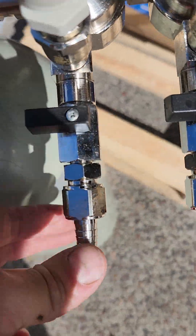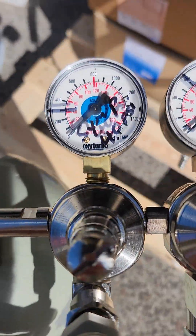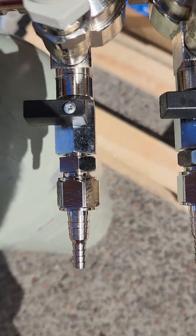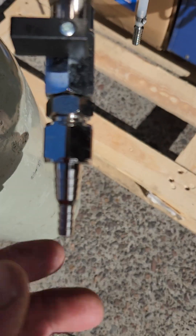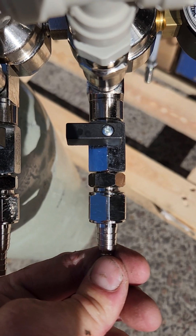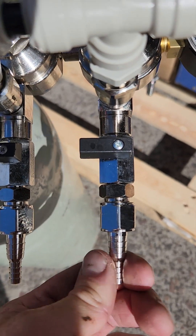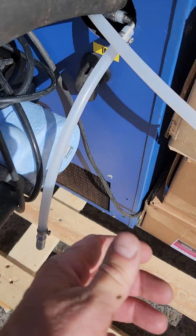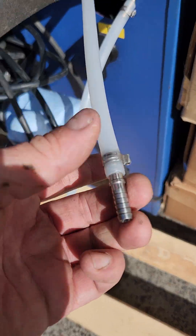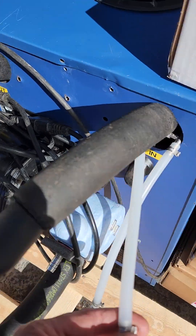This one gets run to the syrup pump board, which will be covered more in the syrup pump section. Same with the carbonator — put a clamp over the line, push it up as far as it goes, clamp it in tight, and run the line to the CO2 inlet on the machine, which is this one here.